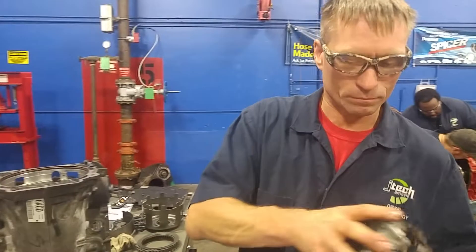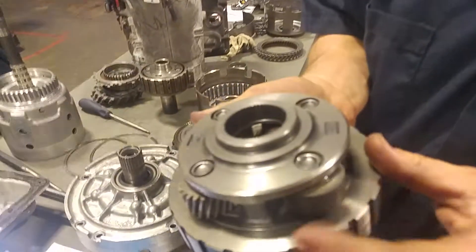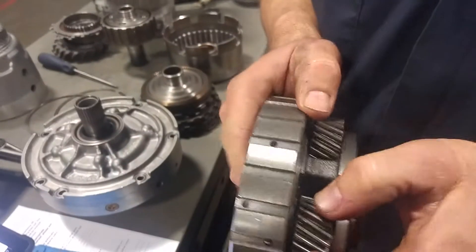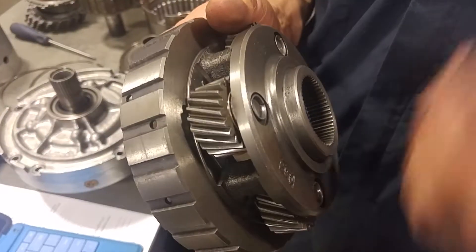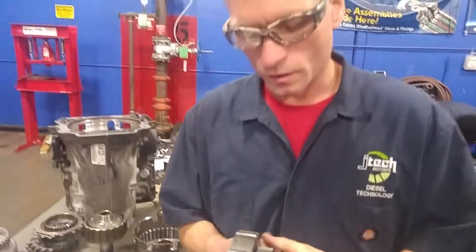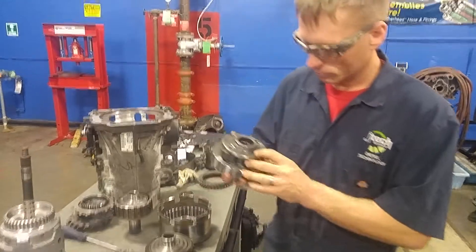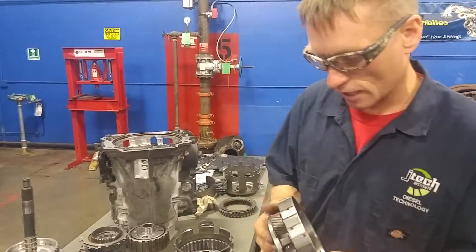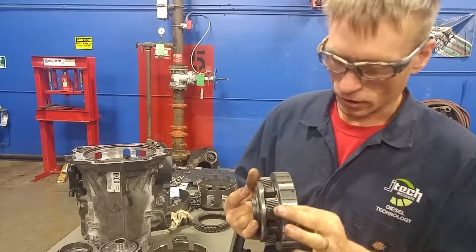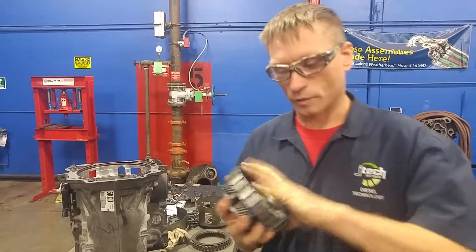That's the sun gear portion of it. Here's your ring gear — or rather, these are the planetary gears, the planetary pinions. You obviously want to make sure that they're all present and there's not a lot of gap. If you tear one of these apart to rebuild it, you're going to want to use the manufacturer's manual. Check your spacing to ensure you've got clearances on both sides, and look for any deterioration or anything loose. Right here is where your clutches will sit — look for any deterioration, broken teeth, or chips that might damage the clutch plates.